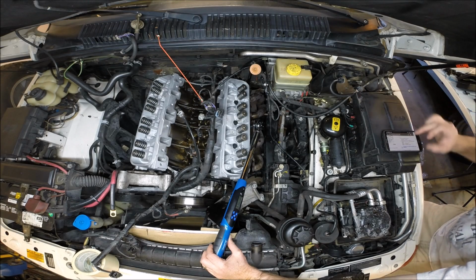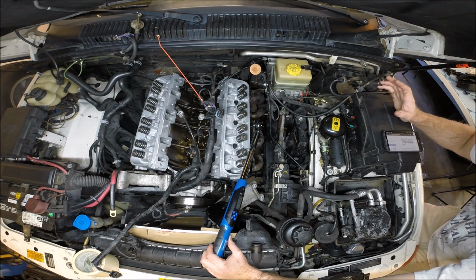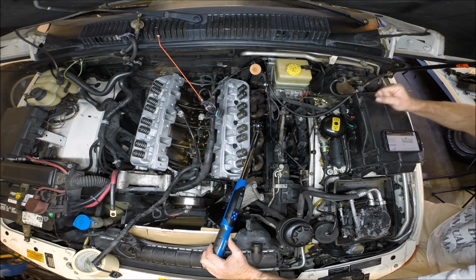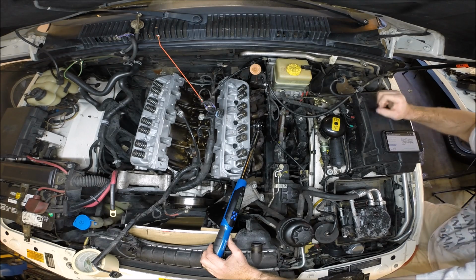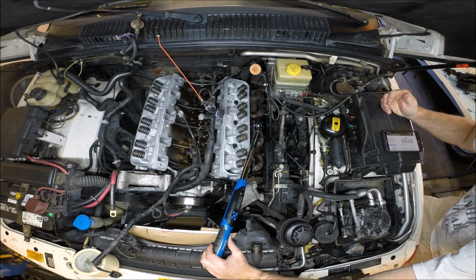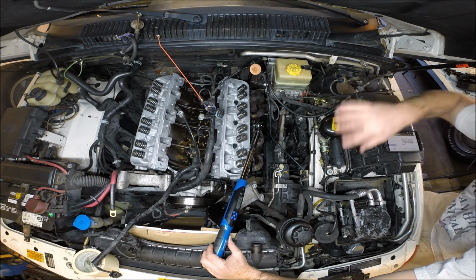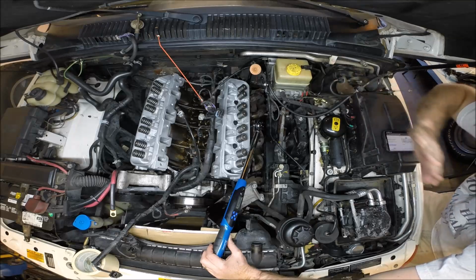We've already torqued each bolt to the proper torque spec in the proper order, and now we're ready to switch over to angle. We're not really interested in how hard we're torquing the bolt now. We're more interested in how far we take the tightening. So we're going to do a 90-degree movement on each of the bolts in the order, and then we'll go back and do 90 degrees again, and then we're done. We walk away, we're done.